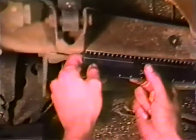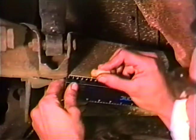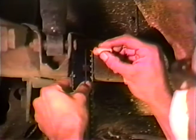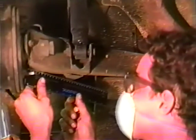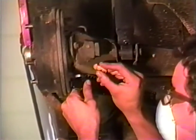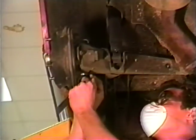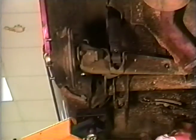To apply the rust-proof treatment, it is necessary to mark and drill an additional three locations on each side — positions A, B, and C. Position A can be located by measuring on the back side of the control arm, 50 mm towards the inside of the arm away from the shock mounting bracket and 50 mm up from the bottom edge of the arm. Mark that location. Position B is located on the bottom of the arm, 30 mm from the outermost end of the arm and 10 mm from the rear corner. Mark this location.